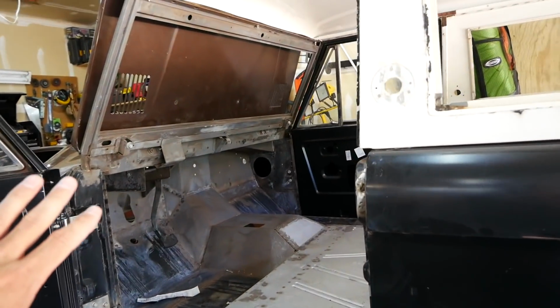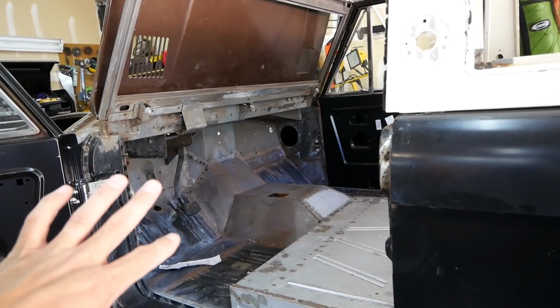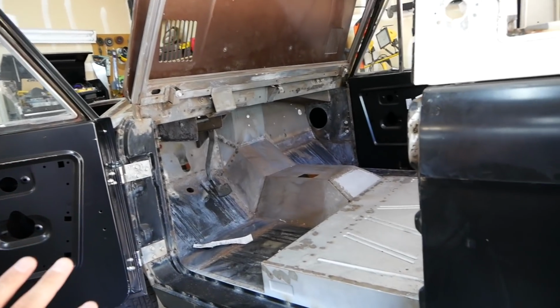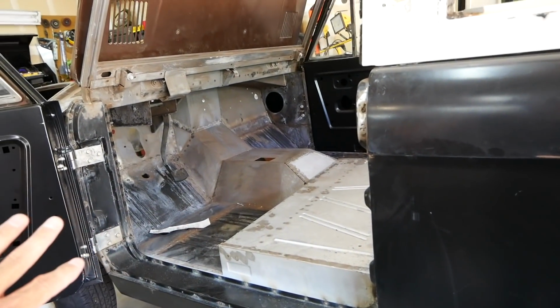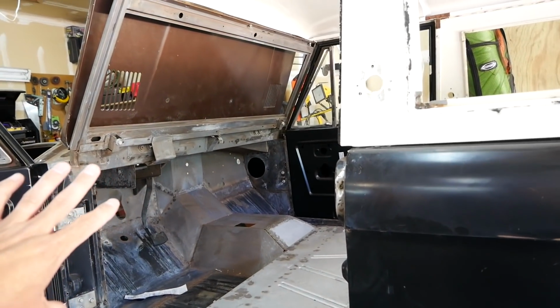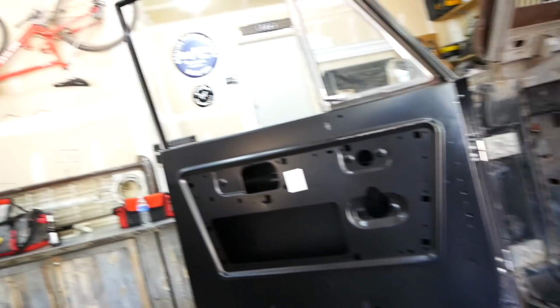There's a few welds that I need to clean up or add welds to that were just tacked in. Do a final go through and everything to make sure all the welds are ground off, and then I'm going to seal it in epoxy primer. Let's do that again.